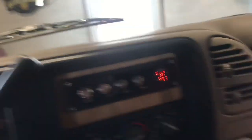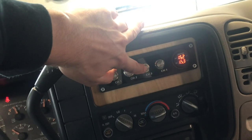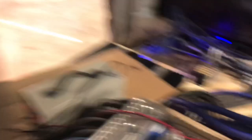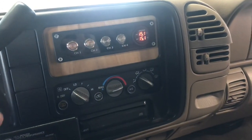In my truck you can see I have the radio on but I don't have any of the amps on — no lights on any of them. Everything is controlled off this toggle switch. Channel 3 turns on all of my amps. Basically, the toggle switch engages a remote wire leading to the remote input side of the relay. If you hit it, you can see the voltage change and all four amps turn on. Turn off the toggle switch and all four amps turn off.